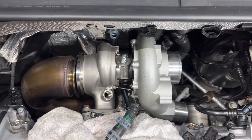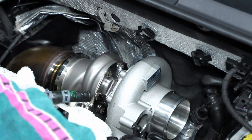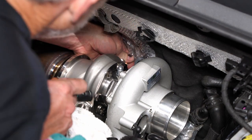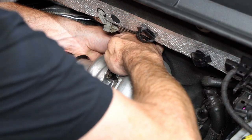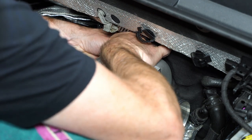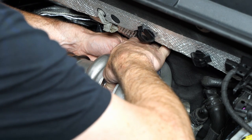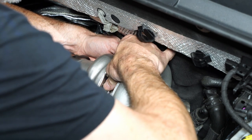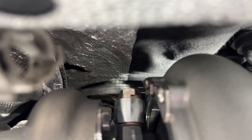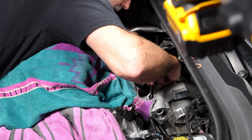It looks easy in the video, but that was probably the most frustrating part. This is a banjo bolt, so you're going to have a copper washer on each side of that pipe sandwiched between the two washers, then spin the stud in and tighten it down. It took a little bit of work to get that banjo bolt lined up to go in straight. Getting all of the hoses tightened down in a way that makes it straight from the beginning will help you a lot. Now I'm safe to go ahead and tighten down the turbo and get it locked into place.